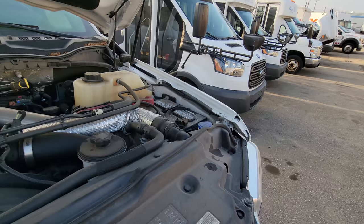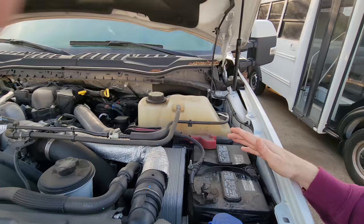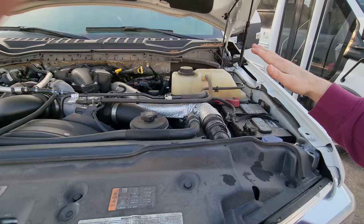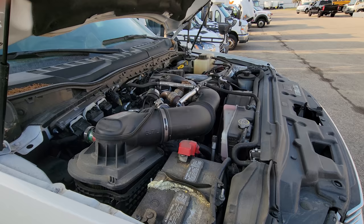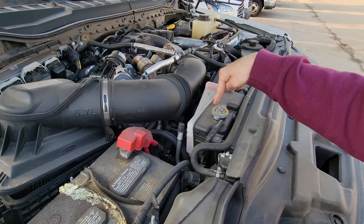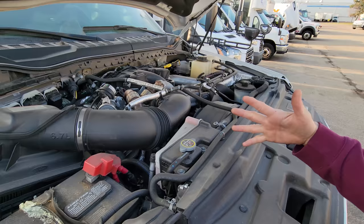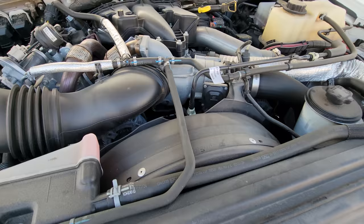On the 6.7 we've got two cooling systems. The primary is for the engine — the heart of everything. The secondary is for all of our emissions system components. From 2011 through 2016 we had orange coolant; some 2017s had orange but then they transferred over to Ford's new Motorcraft yellow coolant. There's a diluted and concentrated blend available — one you mix 50/50 with distilled water, the other you don't. Make sure to check out my interval video for replacing the coolants, which I'll link in the description.